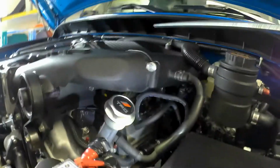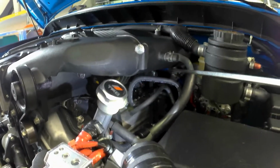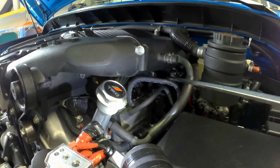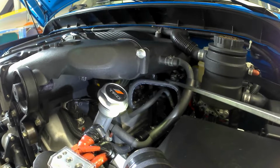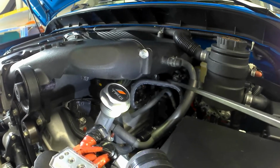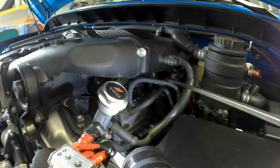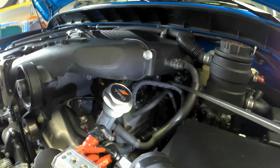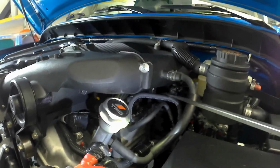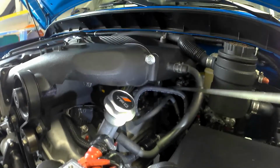Most of you guys that don't have this, you can get into your PCV valve easy. Again, with a 19mm, take it out, put a new one in. I do it about every 60,000 miles, just changing it out because it's a valve and it can get gunked up, and God forbid, you don't want it stuck closed. Being stuck open isn't too bad, but you want it to basically work because it's a check valve for one way. So that's something to do. And I didn't film it, but that's where it's at.